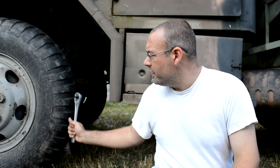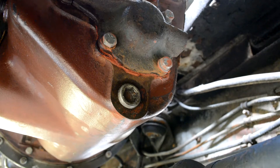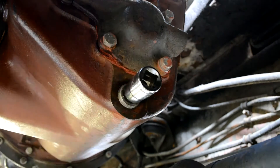We are now down to the ground level of the Deuce. Here's the front tire. The transmission is right here. Let's go over what plugs you're going to be dealing with. You can have all kinds of different types of plugs and need all kinds of different types of wrenches for your Deuce. Here is the transmission drain plug, and as you can see, it is the 9/16 hex plug.